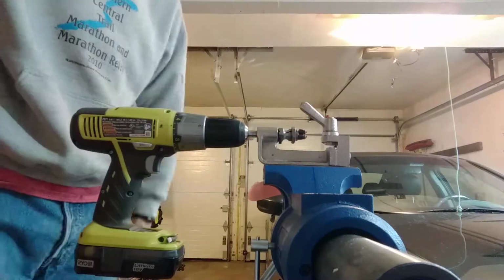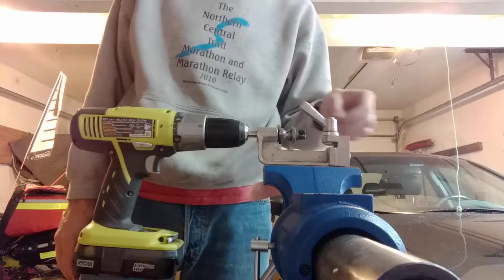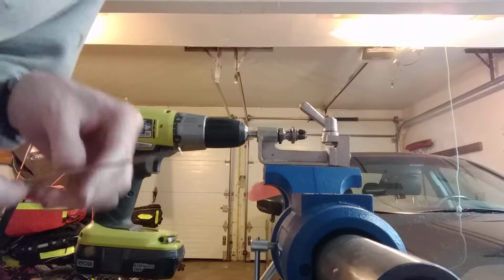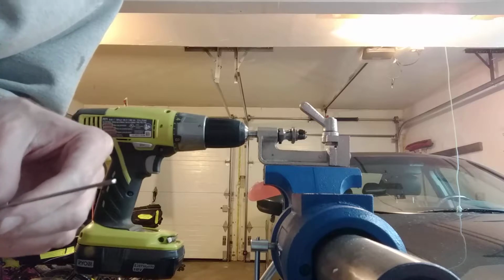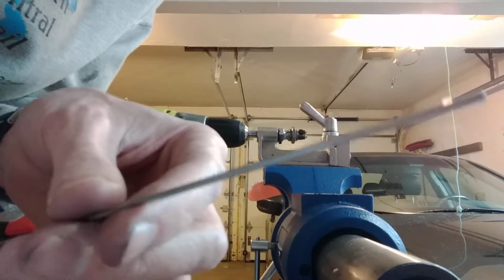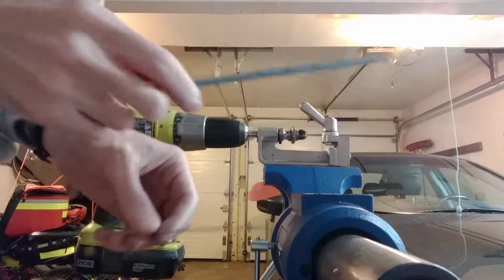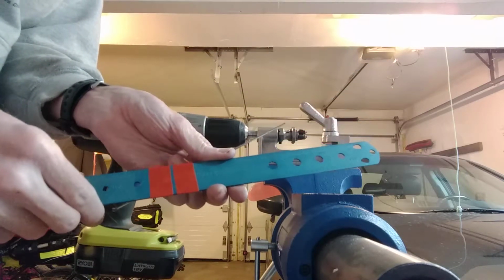I figured I'd make a quick video of how we roll our own here at the house. I like to cut and thread my own spokes because that way it takes a lot of the nervousness out of ordering them online and getting them cut correctly. I measured these all out after putting my measurements into spoke calc on Excel about a billion times.